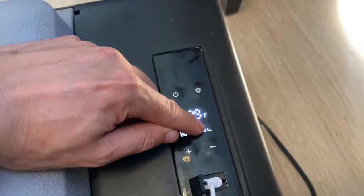You can also adjust this little L. The L is the voltage cutoff, so there's a high, medium, and low voltage cutoff that you can adjust depending on the kind of battery you're using. I'm using a lithium-ion battery which is a little bit low voltage for this thing. If you want your battery to last a little bit longer you would use the middle setting. If you're just running it off your starter battery or while you're driving around, using the high setting makes more sense and it's not going to run down your battery to the point where you can't start your car.